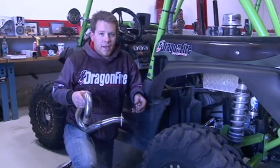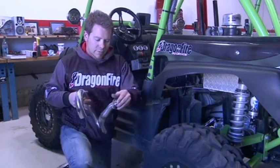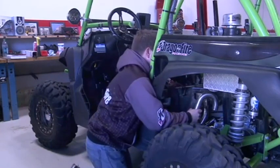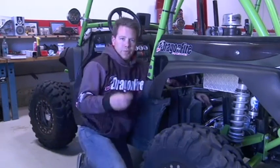After you've loosely placed the front side header, you've got to go ahead and put the back side header. Put the gasket on and then place it in through here. Then go ahead and line up the two and bolt them together.